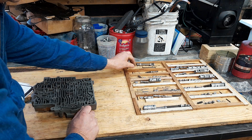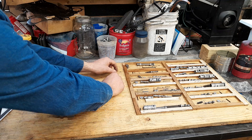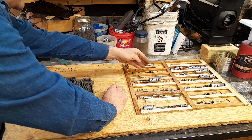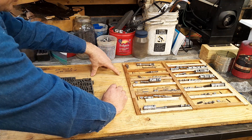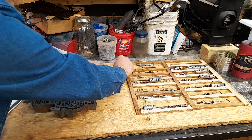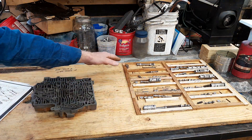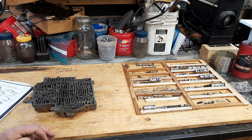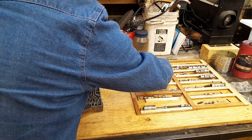So I tear the valve body down and put all of my valves in their appropriate slots. Roll pin on the outside, then the spring, then whatever goes in there. When I tear this down everything goes in here, and then one valve at a time I pull them out, set them to the side in the correct order, wipe the little slot out with a rag soaked in kerosene, set them out to the side, wipe the thing out, then wash the dirty parts and put them back in the divider where it goes. I do that for every spool and every valve.